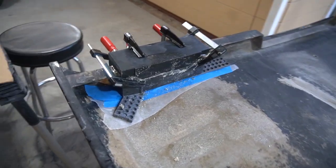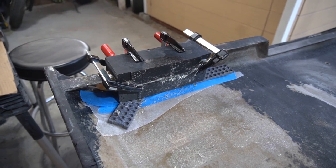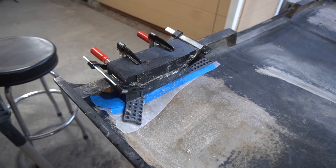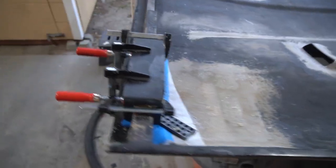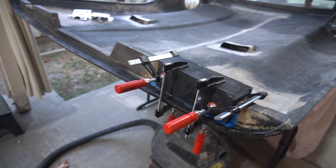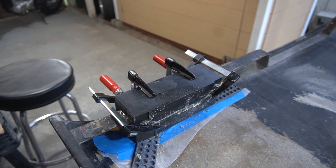Okay, here's the two molds clamped up, and I've cleaned up a bit of the excess mess. As you probably saw in the video, the fiberglass layup extended further than this edge, so I'll be trimming that back, and hopefully I have built up enough thickness, and hopefully these molds will be removable. Hopefully I won't have to cut them out, but I'll deal with that tomorrow and see if after unclamping this they come apart or not. So this is all I'm going to do for the evening, and I'll bring you back tomorrow for the unmolding.